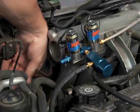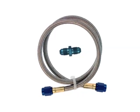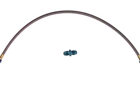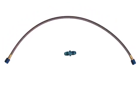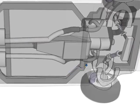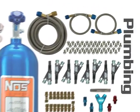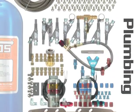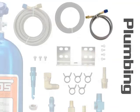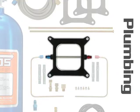After running the line, if your hose path causes you to end up short of the proposed mounting point for your NOS solenoid, you do have an option. You can purchase a 2-foot high-pressure line extension that will finish off the path and still let you retain the longer route that you initially ran the hose along. Now your empty bottle is installed and the nitrous feed line has been run to the engine compartment, so we're ready to move on to the rest of the installation. The next items we'll deal with are the nitrous solenoid, its filter, the high-pressure line that connects the solenoid to the discharge nozzle, and the next item up for install — the discharge nozzle or spray bar itself.